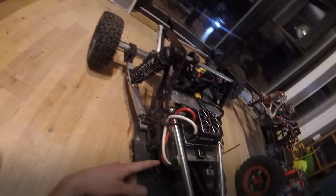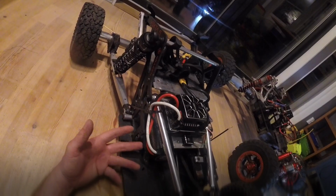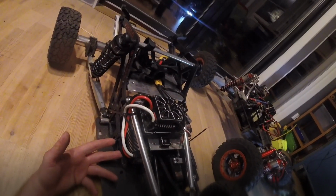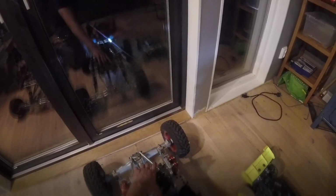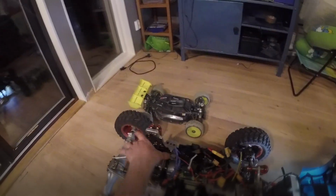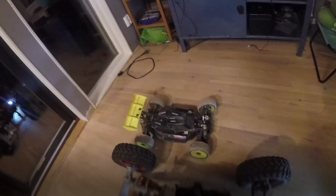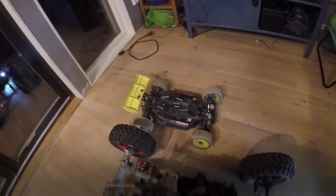Here's the motor. This is a Castle motor, the same 2028 size Castle that's in a lot of cars nowadays, compared to the Voltz that has a bigger motor stock. This is not the stock motor, but it's the same size. The motor I have, it's 480 kV, 70 millimeters diameter and 12 centimeters long, so it's a very big motor, almost 2 kilograms actually.